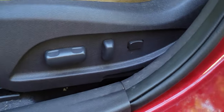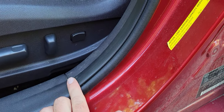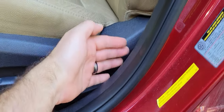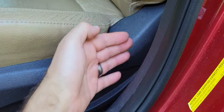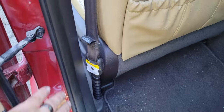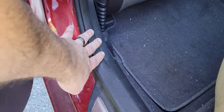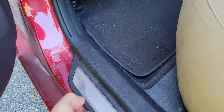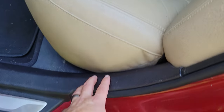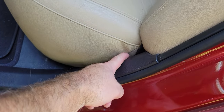Not a big deal at all. Then you'll come over here, and when this is off, you'll pull this trim piece just out. This gives you enough room to pop out and run the wiring right down through here. Then carry it on back through here — same thing, this just pops up with your trim tool, a couple of clips, and then you'll run it back behind the seat.